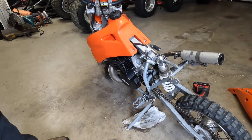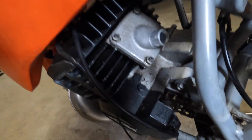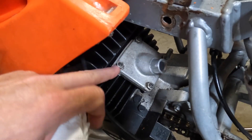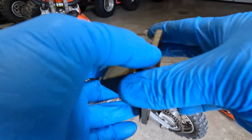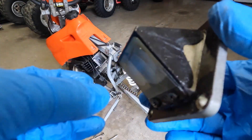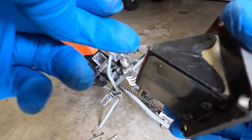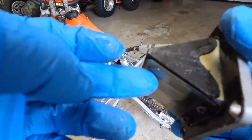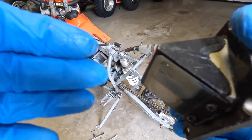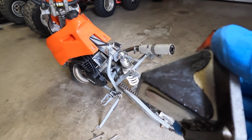Let's put the carb on the bench for now. I'm going to take the reeds out and look at them. I got the reeds out and if you guys can see here, you can see daylight through there — and daylight through there. So these reeds: I'm going to flip them around to try to eliminate that, because they shouldn't be open like that; they should only be open when the motor's running. That's one of the problems right there.